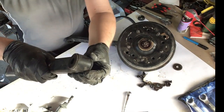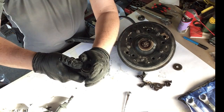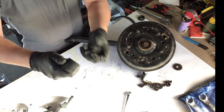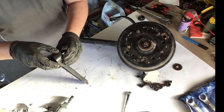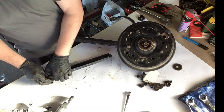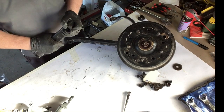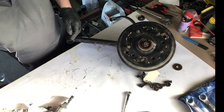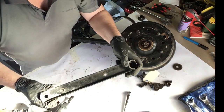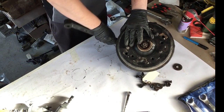These bushes, I believe they were replaced by the previous owner, but after sitting around for at least 20 years, they've got dry rot and they're no good. So in the bin they go. I'll put some polyurethane ones in there instead, which should hopefully last the rest of the life of the car. I'll press them out afterwards. But as for the arms, they're not flogged out, they're looking in pretty good condition. So yeah, happy with that. So look at the other side.